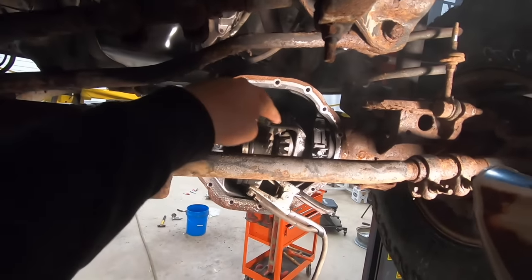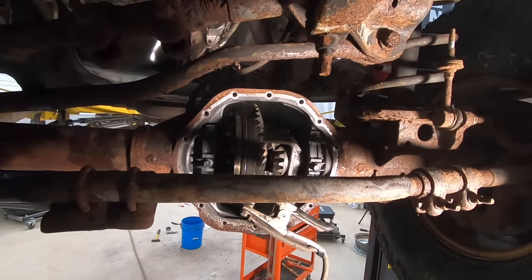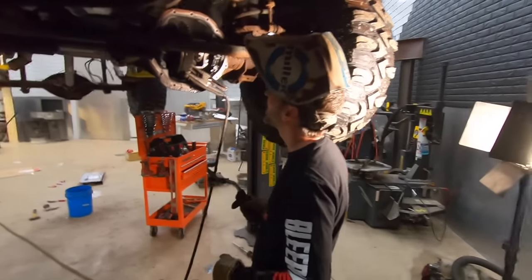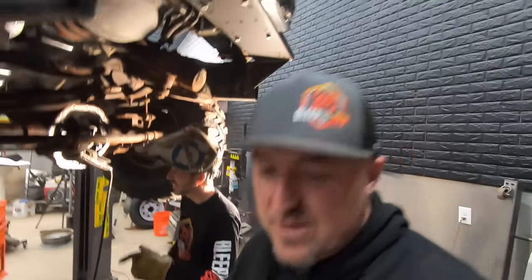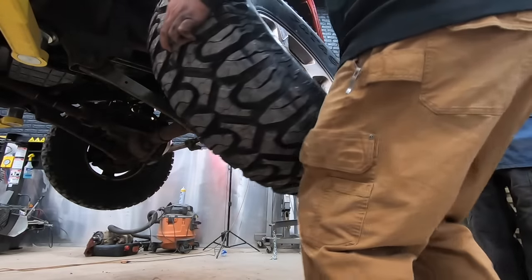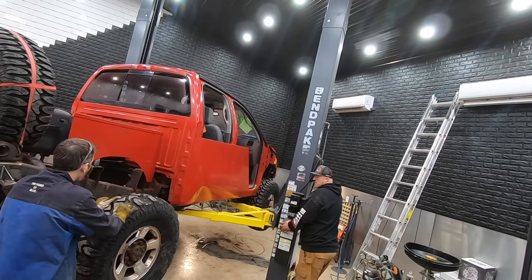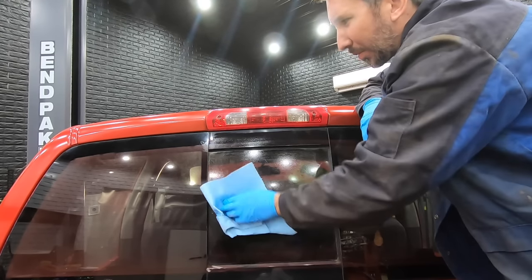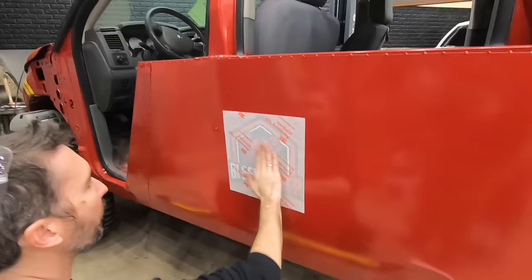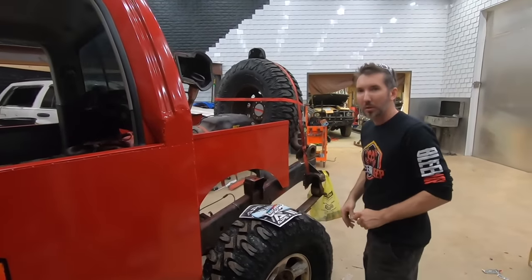And I've had the best luck welding all the teeth together and then the teeth actually to the carrier, because once you burn the teeth together, you can't get them out of the carrier anyway. What'd you call it? An orb of traction? Yep, orb of traction. That's the official locker name when you weld it up. Matt, I think it's missing something. What?